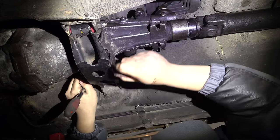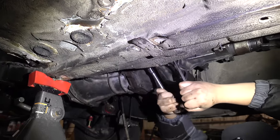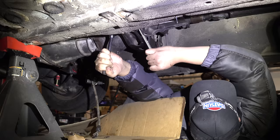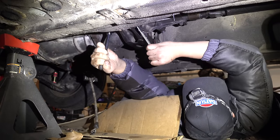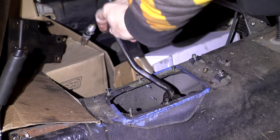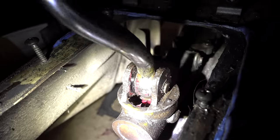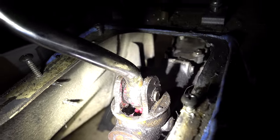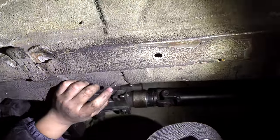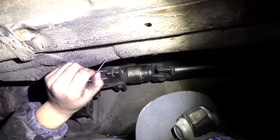Transmission cross-member — it's a dinky one, but it's nice and simple. I like how simple it is. These nuts were just completely loose — it's kind of a running theme of this build if you haven't already figured that out. You see the bottom? You see how it's stationary? There's no bushing in it — all the plastic is gone, it's just missing. And there's a nail — someone hammered a nail into the undercarriage of the car.